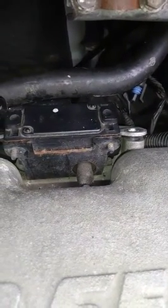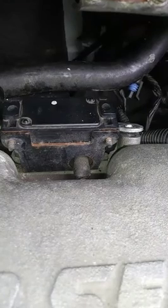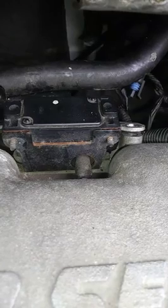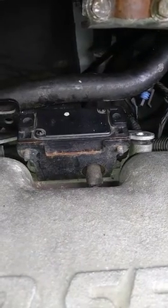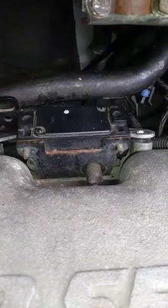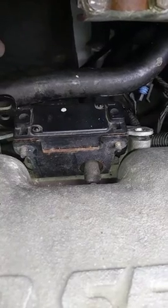Now, a lot of times, these things, if anybody's ever changed the plugs in them because they're so irritating, you'll have two nuts down there on those two studs on the back. A lot of times, people will not put those back on there because, like I said, they're irritating. So what you'll end up having is just a bolt here and a bolt there, which is fine. It's enough to hold it. It's not going to go nowhere. But I've seen videos where people are taking it apart and they just had these two and they said, well, you know, there's no nuts back there, they don't have them. But if the plugs haven't been changed or if somebody put the nuts back, they're there. So when you take these two out and they don't come off, that's why.